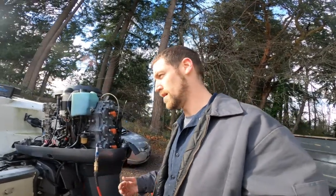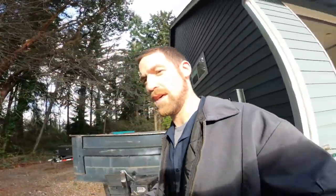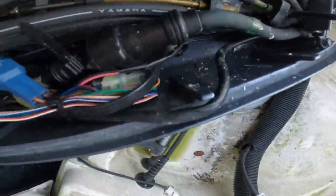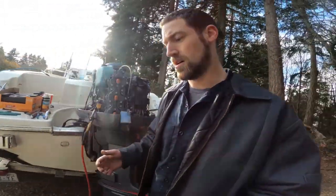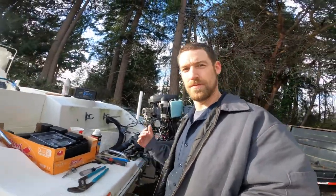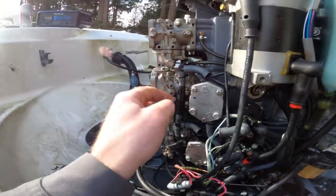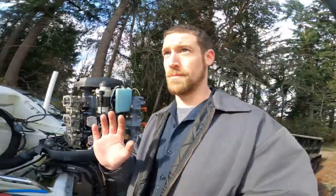What's happening is the motor's not running - it runs on ether but it won't run on gas. We found that when we blew everything out in the bowls we got all this sludge - all that white sludge. I think what's happening is the owner has been running ethanol fuel and it should be running marine grade fuel. It ain't picking up off the fuel coming through. We know we've got fuel coming up when we crank it, the pumps are working, we're getting fuel to the bowls - it's just not firing off. Everything is gummed up in there, everything's just gone.